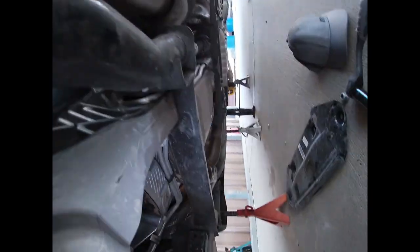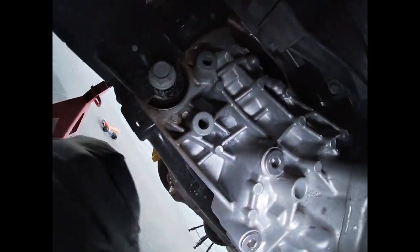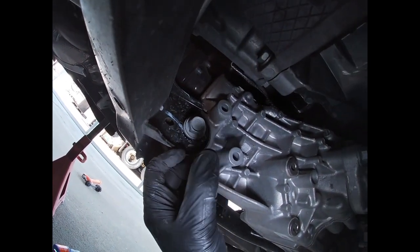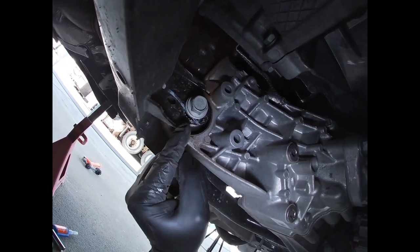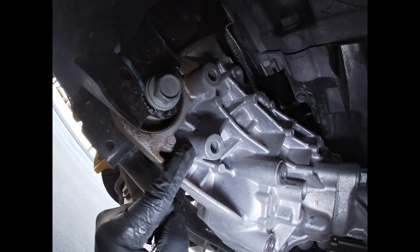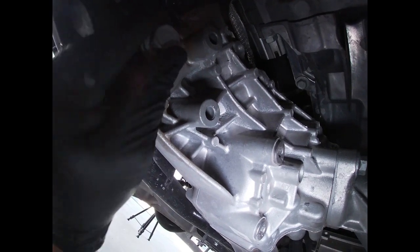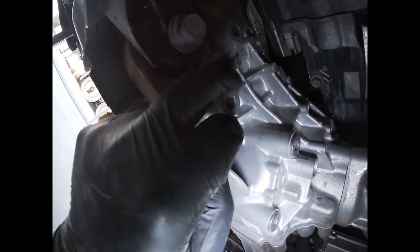But before I install the skid plate, I'm going to go ahead and install the differential mount. I already started loosening up the bolt. Basically this bolt's going to come out. And because the spacer or the differential mount is a lot thicker, we're going to use a different bolt that comes with the kit. This is the part where we have to do our tap into. You'll notice how this one is smaller than this one — it also comes with corresponding bolts that are bigger and smaller. This is an 18 millimeter. The bolt comes off.